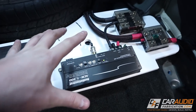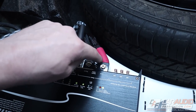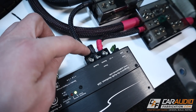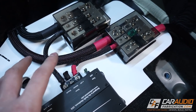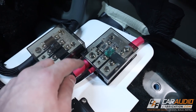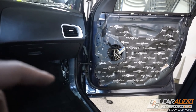Now what if your amplifiers didn't turn on? What would you want to check? You would want to use a multimeter and test to make sure that you have 12 volts on the remote in as well as the constant on each of the amplifiers. If you don't have 12 volts on the remote in, that means something is going on with your source unit. And if you don't have 12 volts here, it means one of your fuses is already blown — you definitely want to look into that as a potential issue. So you'd want to check each of these different connections to figure out where you do have 12 volts in order to determine the culprit. It's also a good idea that at this point you would have probably connected your speakers already too, so you could start right into doing an audio test.